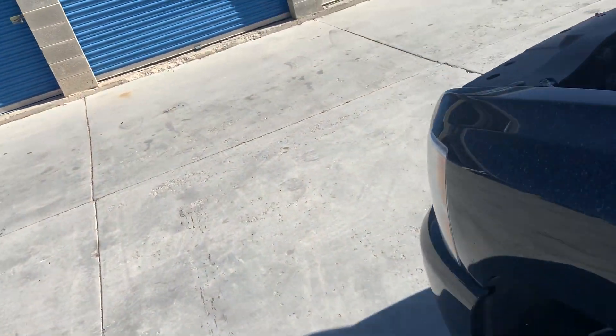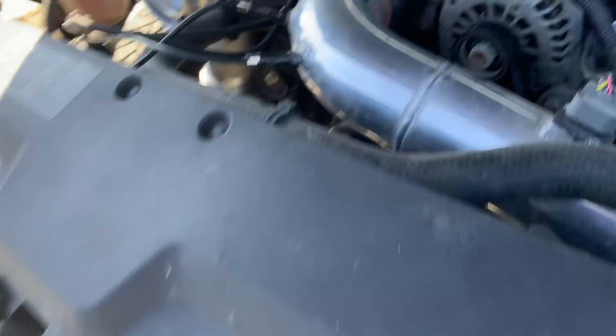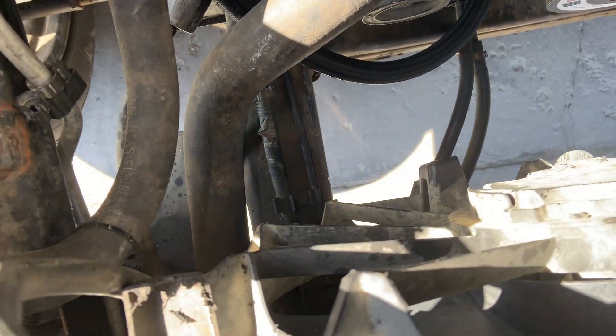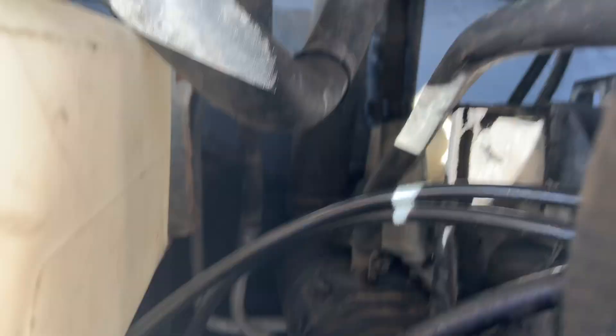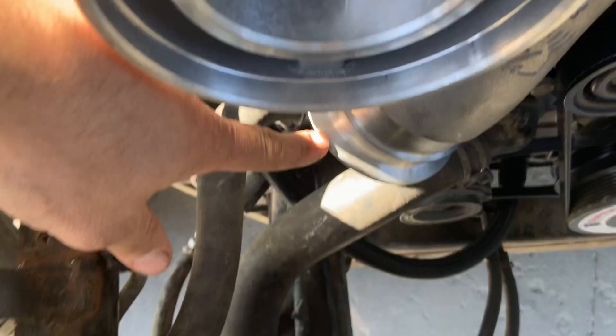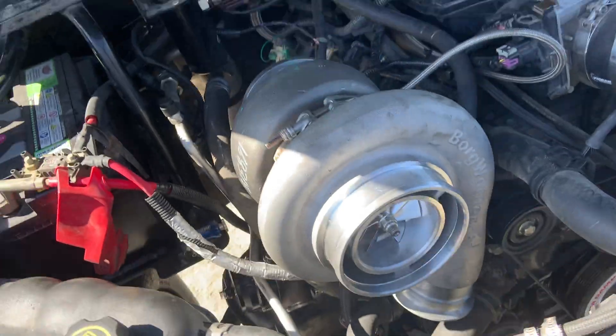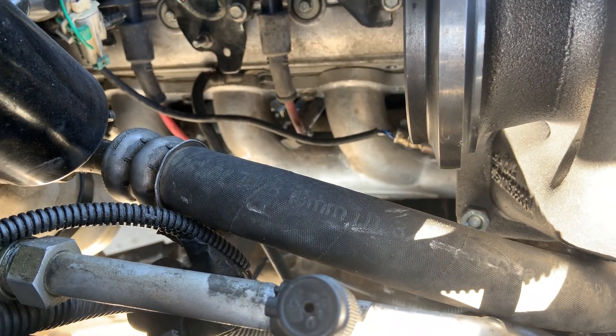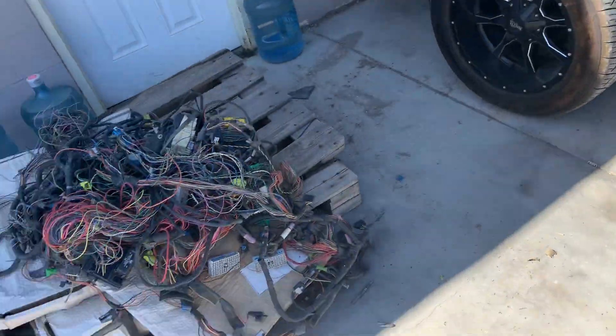No cold side is adapted yet - he's not opting to go with a bigger intercooler, so I'm going to have to adapt the intercooler piping from down here up and into this, which is V-banded. We already have a downpipe made but it's not installed yet because I'm waiting on a custom dipstick that has to be bent and shaped.